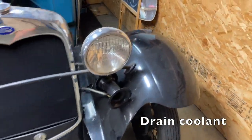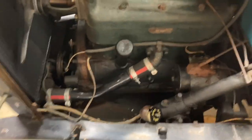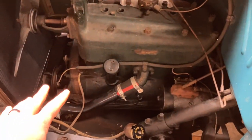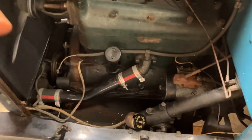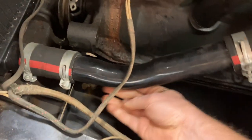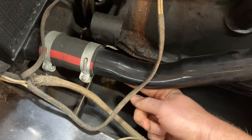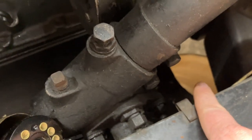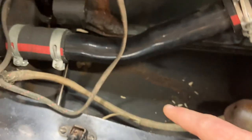The first thing we're going to do is drain all the coolant — always the first thing you should do because the coolant is all through the radiator and the cylinder head, on a lot of pieces that you're going to take off right away. Reach under here and turn the petcock to release the coolant. If you have engine pans, it'll flow down here to a bucket you've intelligently placed right there. If you don't have engine pans, it'll just drop right through, so put a bucket down there.